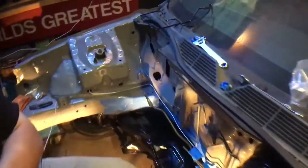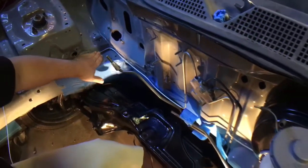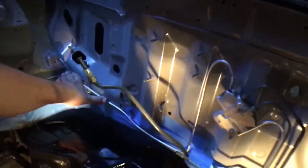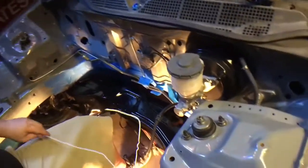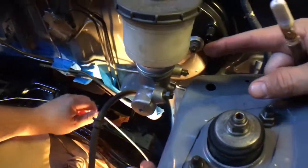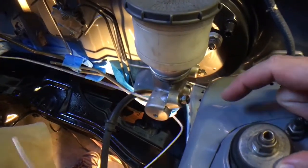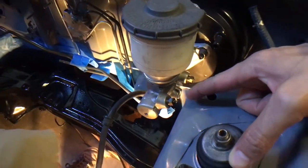So Fro's got the passenger side done — let's see how tight that runs. Clean, it'll even be better when we clip it down. Got it to go underneath there. He's just got two more lines to create, which are kind of a bitch. We opted to go for a GSR version — the GSR is a one-inch bore. There's an SI that's three-quarter inch, and the EX and DX come with like a half inch. We want the GSR because it is a larger bore, gonna give us more braking power. Problem is it's not designed well to clear this area.